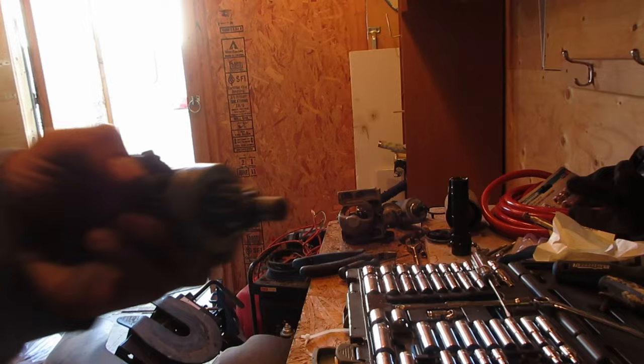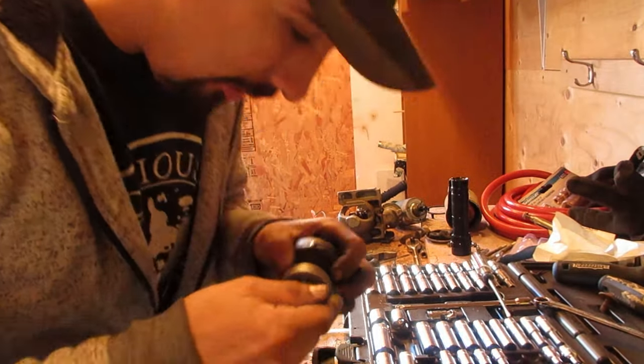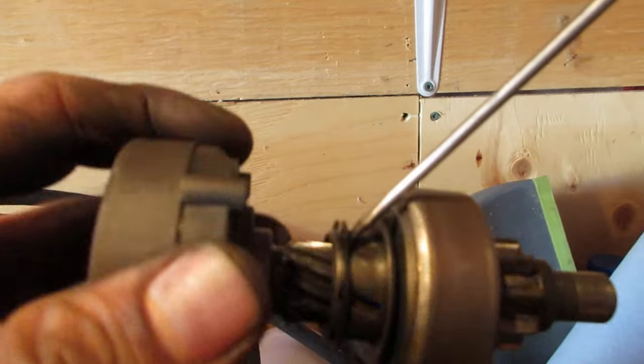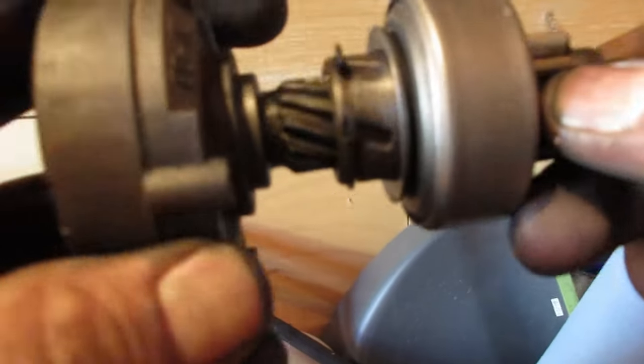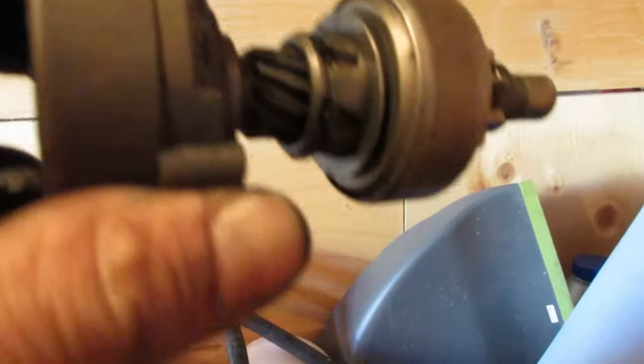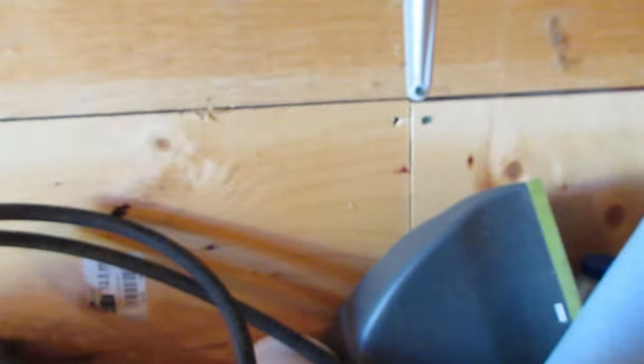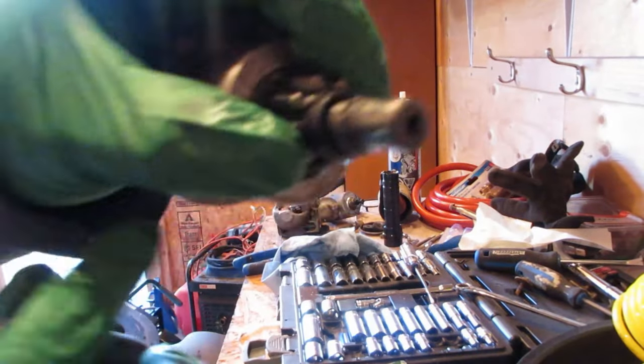I have some really cool neighbors — he had a kit of snap rings, a universal kit, and one just happened to work. I put a snap ring here and that should pull the gear back when it disengages. Don't forget there's also a snap ring here that I had to pull off to get this collar off and remove the rest of the gear assembly.